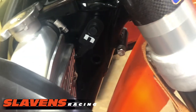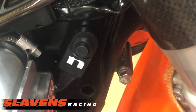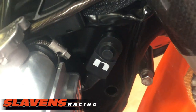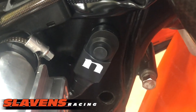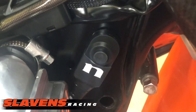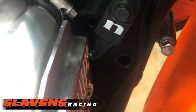I mounted mine on the frame tube. It's mounted in the air box — they come with a three-foot-long cable on them. It's very high quality, with a really nice shield; it's one of the nicest harnesses I've seen in a long time. It's super easy to install: it's got double-sided tape, so I stuck it on there, and then there are just two leads coming off — one goes to ground, the other goes to power the kill switch. You don't even have to take anything on the bike apart if you don't want to, but I did it when I had my tank off.